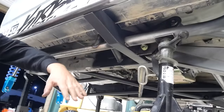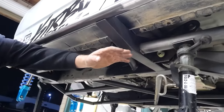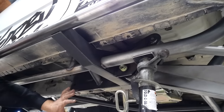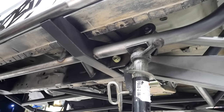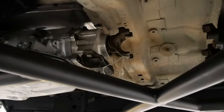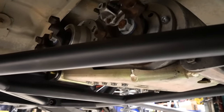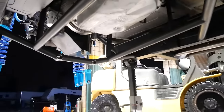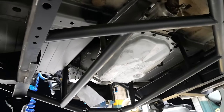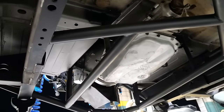This is all three-sixteenths — it's actually going to stop me from crunching up the body. I'll make this tube stronger. It's all based off the stock frame, which gives me more room. We're using the Atlas transfer case — an old one from the Ultra 4 that won't work for Ultra 4 anymore, but it'll work for this no problem. It's got a 480 built with all 300M parts. Colhane did that one — I've had a lot of good luck with Colhane. He knows his product so well.